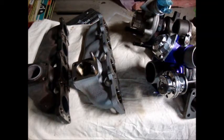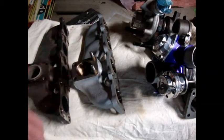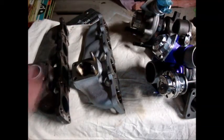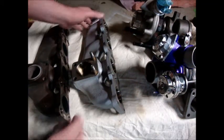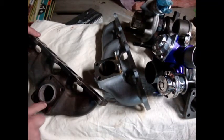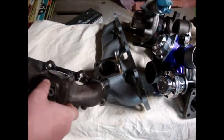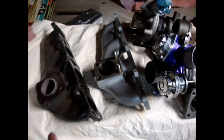I'm going to talk a little bit about the exhaust manifolds again, only because I happen to have them here and they lead into the turbo — literally and figuratively. First off, you'll see that there's this white doughnut here. This doughnut is actually raised, and it's there to idiot-proof the installation of the turbocharger.